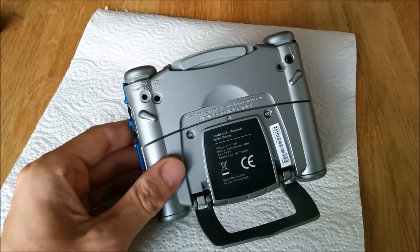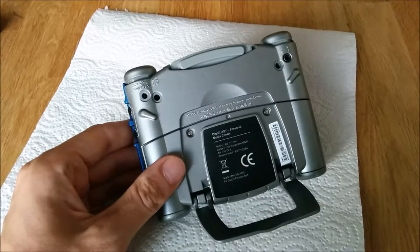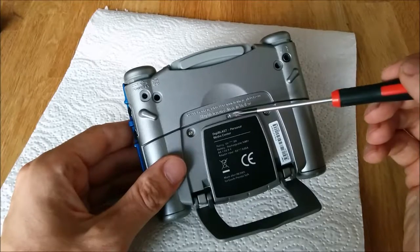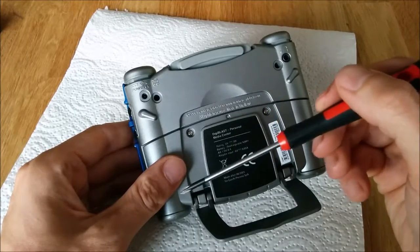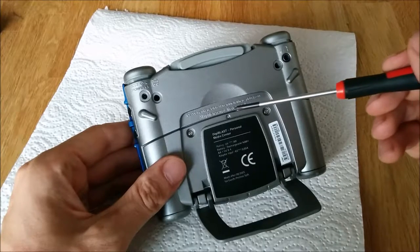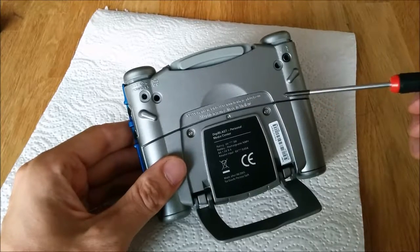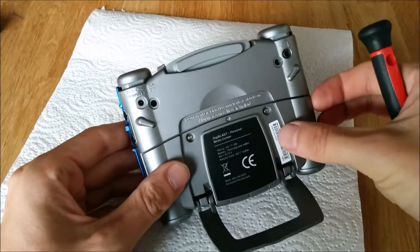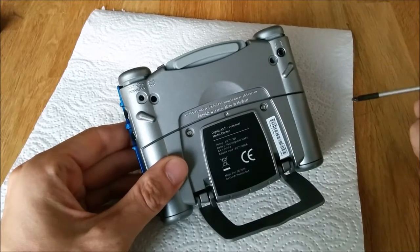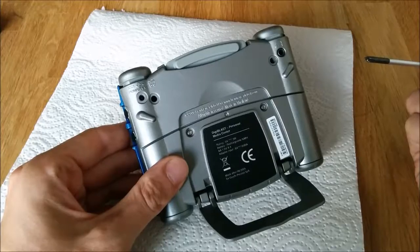To open the Digi-Blast, remove those two screws here. And try to pry it open slightly, because in the European version, the battery plate is glued to the case. So in this area it is glued, so take some kind of credit card or similar, and lift this up after the screw is removed. Pry it out, but be very careful.